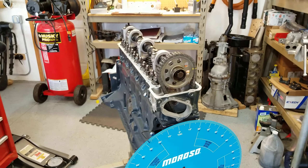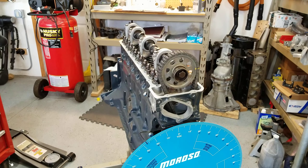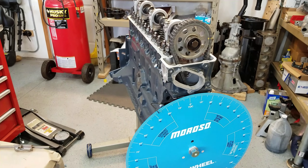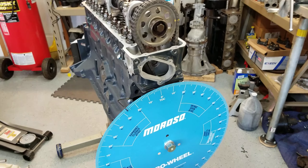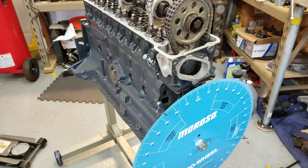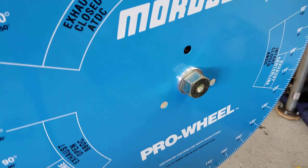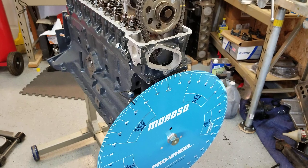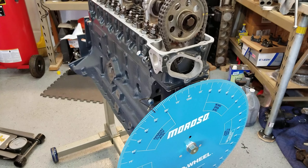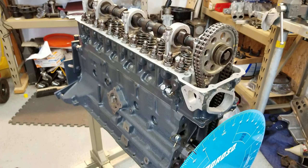Hello, welcome back. The Engineered is back in Racine, Wisconsin. So last video we found top dead center on the 280 block, and that was pretty easy. But I had to take the degree wheel off to get the cylinder head on and get the chain drive and all that stuff located on the engine. When I popped off the degree wheel I had to loosen up this bolt here, and I had to bump it pretty hard counter-clockwise to get the wheel off, and I wasn't sure I hadn't moved the actual crank itself.